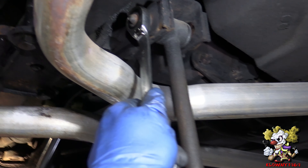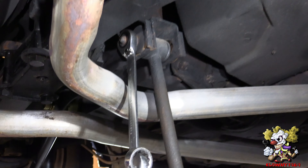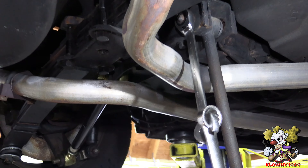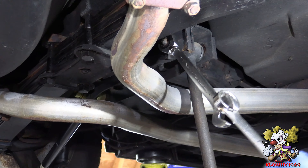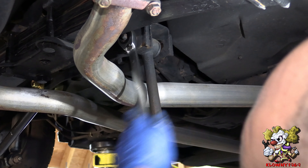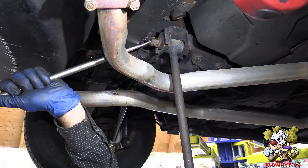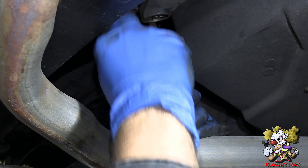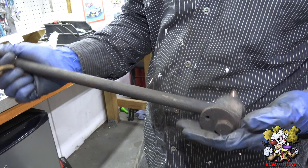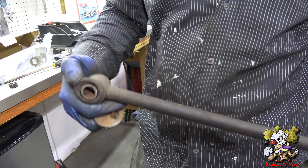Okay, I'm going to see if I can budge this loose a little bit. It's three-quarter inch — two wrenches on it. Put a pin on that tube and smack it. Now you can put all this stuff off. Look how bad that was — the bushing was completely deteriorated.